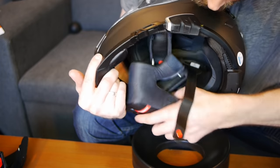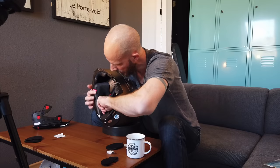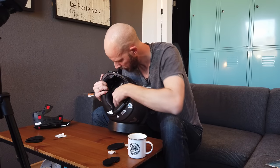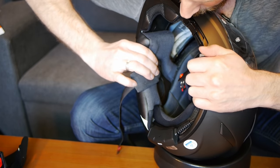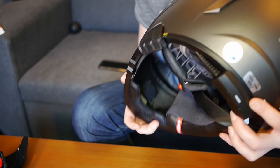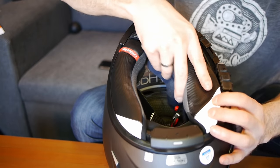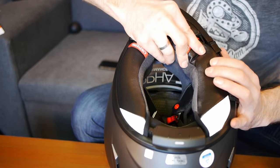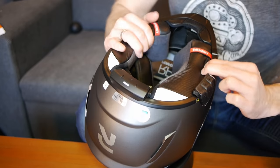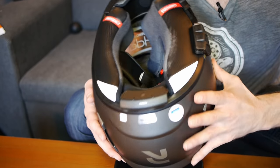Cable into the crease there, folded all over. Putting this headphone connector piece in between those two foam pads so everything stays in place. And then there's the first popper, there's the second popper, and last but not least the one up there by the top of the ear. Microphone in place, cable running straight into the cheek pad. The other side is considerably easier because there's not really many cables to worry about. Plastic bit tucked in between EPS liner and shell of the helmet — a little bit more faffy because the intercom is now taking up some of the space. Battery unit centralised at the rear — a very tidy back end.